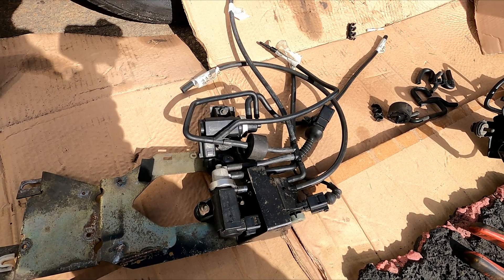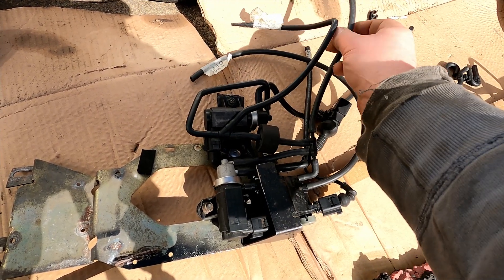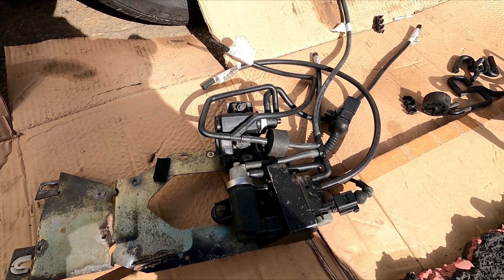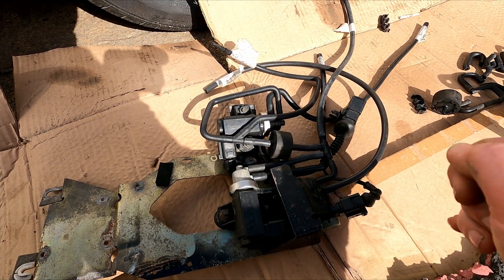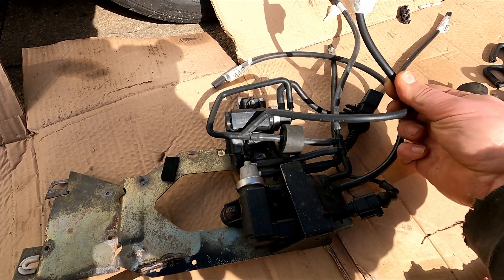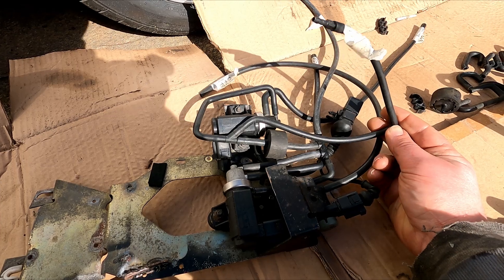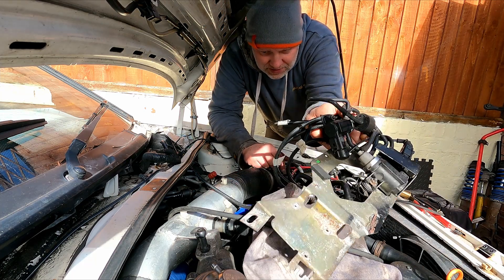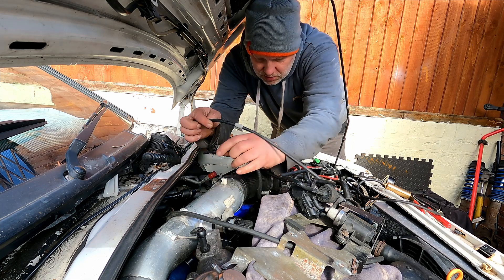The other reason I want to keep it factory is the way these lines come out. There's the accumulator — that little sphere on the front — and that one's off the servo. If you had one of those instances where the engine is running on its own oil or other substance and you're trying to turn it off, the shutoff valve hooks into the accumulator. It'll use the vacuum on the accumulator to shut it off rather than the servo pressure, because you want to keep as much servo pressure as possible. It's an absolute failure-mode safety item.